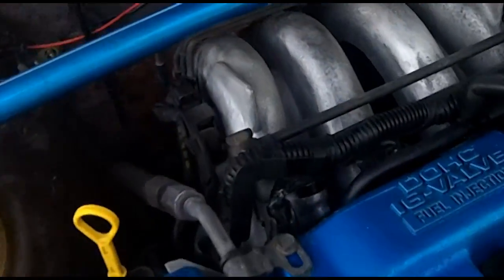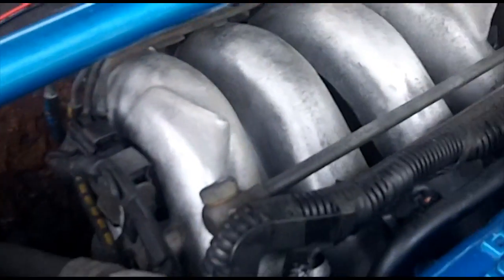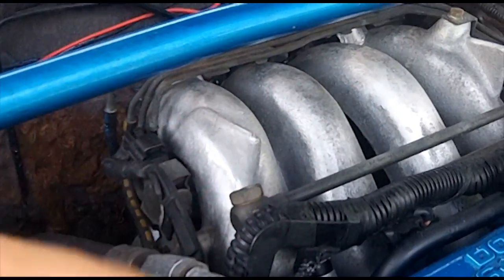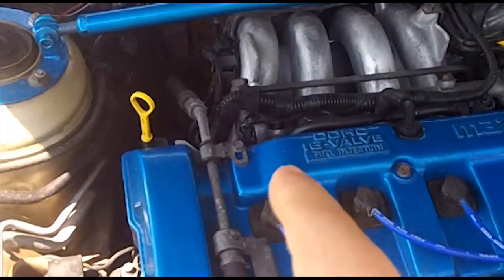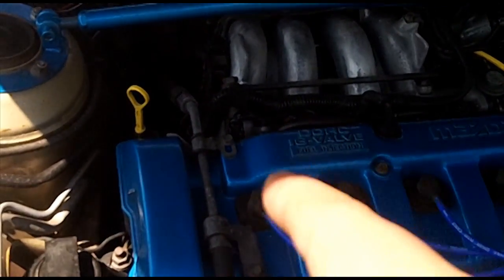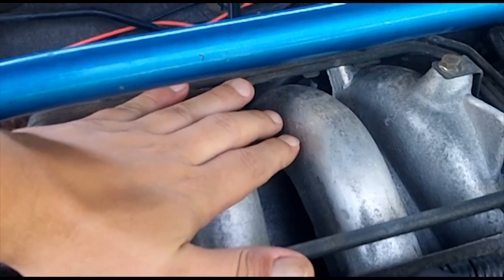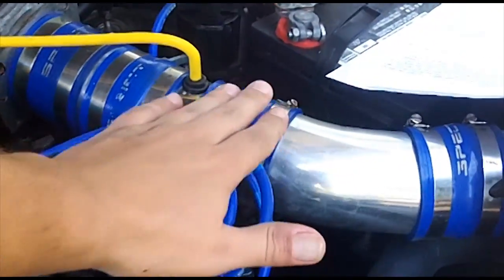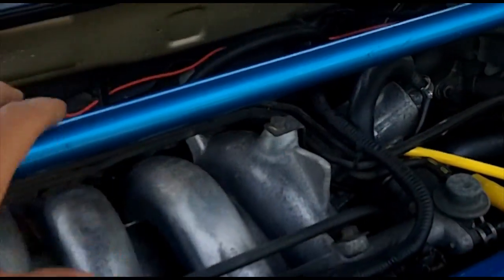One question I had was, does the Purge solenoid actually create vacuum? No, in some cars, there are dedicated vacuum pumps that will aid in the vacuum as a secondary system. Normally, your cylinders are the sole contributors to vacuum. Every time a cylinder goes down, it creates suction. That's where your intake manifold will suck in air from your intake. So that's why you will hear a sucking sound sometimes from your intake, because it is actually being sucked.